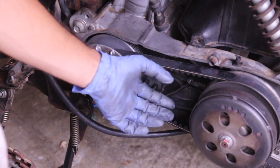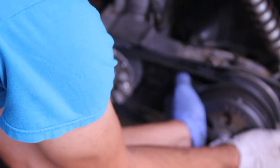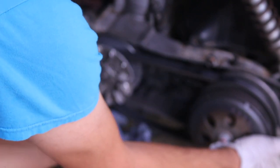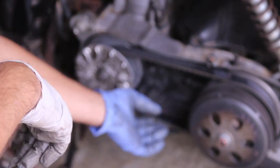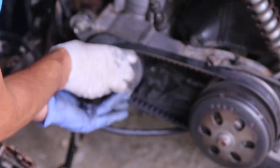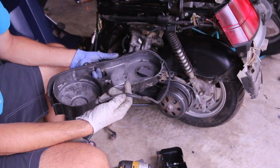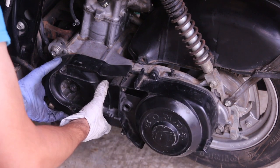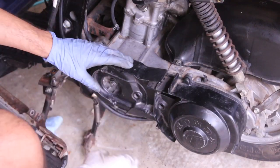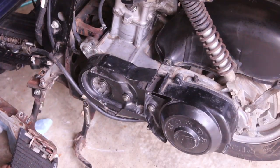The way to get it on is to kind of squeeze this in and loosen it. If you can get a lot of slack, you can actually kind of squeeze the belt off of the bike - it's that easy. That's how you get it on. It's kind of loose, and then as you're moving it tightens up. The cover is interesting because I thought that this gasket was broken, but that's just how it is - it's just a dust seal. Two bolts go right in here. We're getting somewhere with this bike.